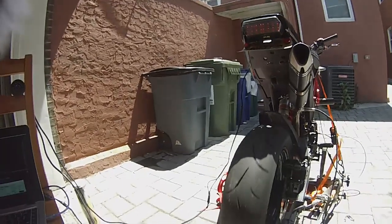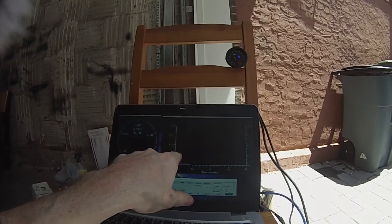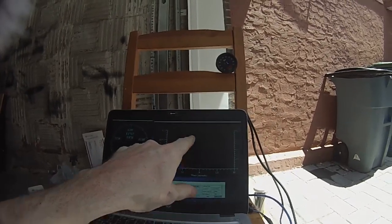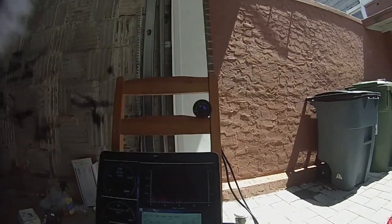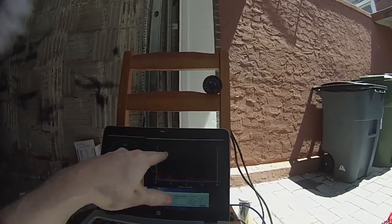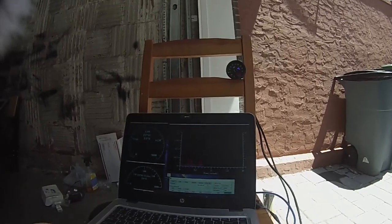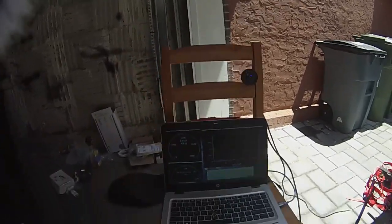You can see here we got the tire spinning. And you can see at idle we're making on average about 0.2 horsepower, and we got an 11.5 to 1. So if we get that a little bit closer to 12, we should see this horsepower go up. Now if we tune the air fuel ratio down, it's going to drop the power — and I'll show you what that looks like right now.